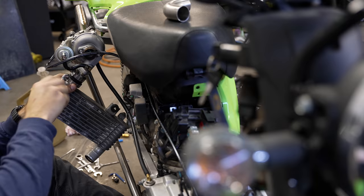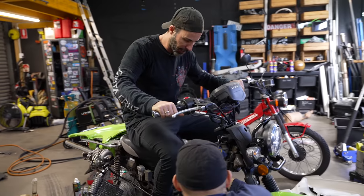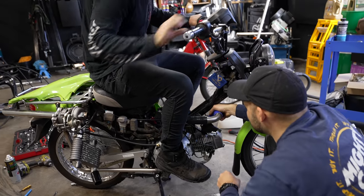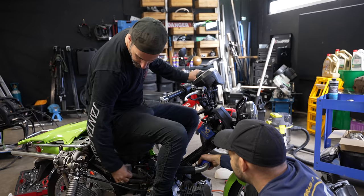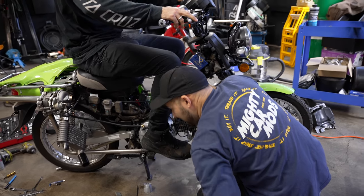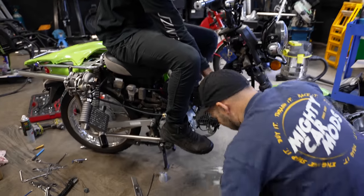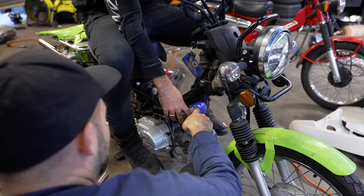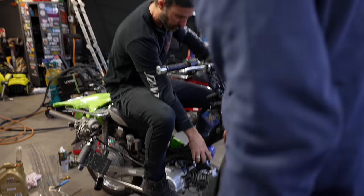All right, so we've just got to work out the piping now from the cooler into the engine. Your two options are to go back that way, or down and sort of under your foot. Through here — yeah. How hot's it going to get? Not that hot. I don't think it's going to make much boost. Like here and then down, I reckon. We need to put our blow-off valve onto a little adapter pipe, which is this. We'll weld that on — and then just have it like that. Yeah, awesome. That's great. It's so good.